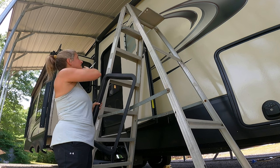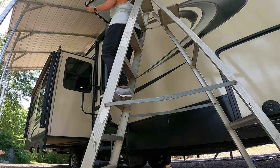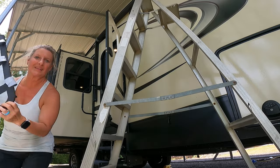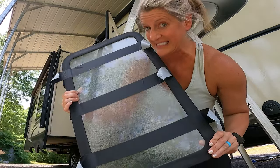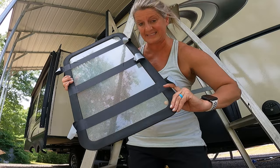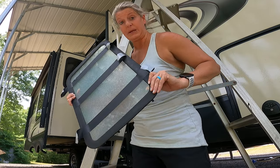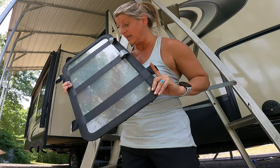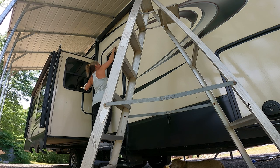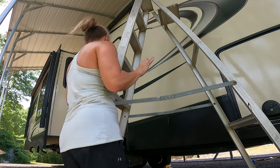I'm glad that I have it taped in. I'm going to finish getting this window out. Make sure that the glass doesn't fall out — I just pulled it off the actual door and left it on the glass and the frame, because this piece of glass would have fallen out and been a mess. The tape is a must. I just used gaff tape. I took some Clorox wipes or alcohol and cleaned off around where the window is going back, then dried that off with paper towels.